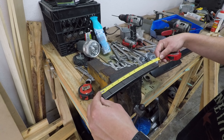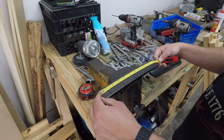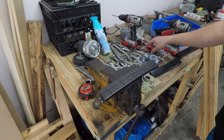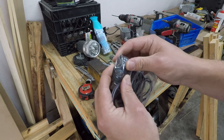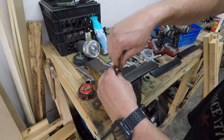I've marked out some lines — all you have to do is measure. It's roughly an inch and a half, so 0.75 gives you a pretty good half, and then it's in the middle right at 10 and 10-5/8, or almost 10 and a quarter. I just do an inch in, inch in, and then two inches in between roughly — they don't have to be perfect, they're just turn lights. I got my lights on Amazon; I use these smoked amber ones but he wants regular amber.